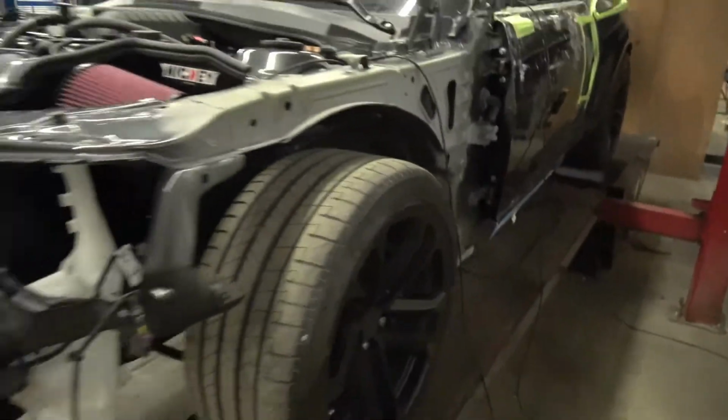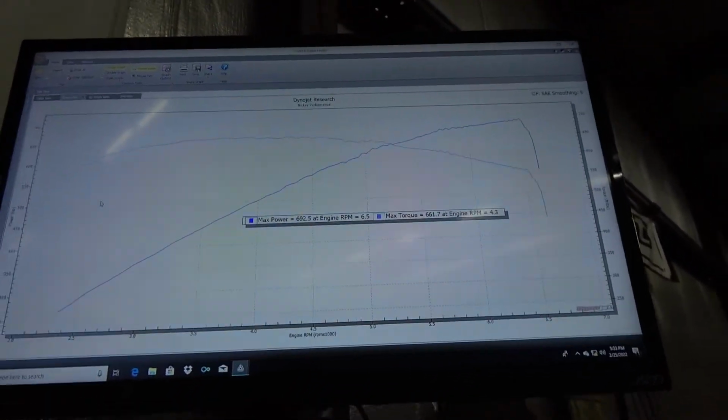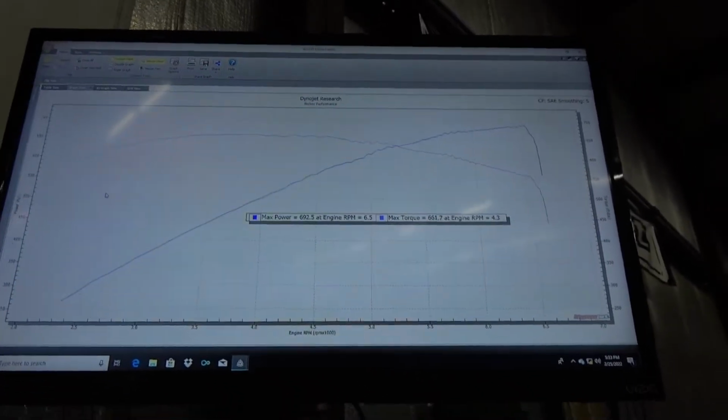So yeah, I'm in the middle of tuning. I just flashed a tune in. I picked up the camera here, and let's just go along for the ride for this next pull. So this is where I'm at so far. I always go air fuel first, set the timing conservative. Get the air fuel dialed in, then start laying in some timing. So I just did that.